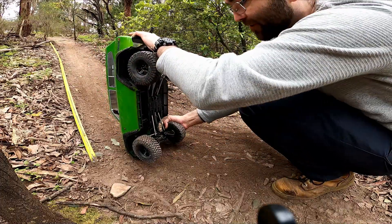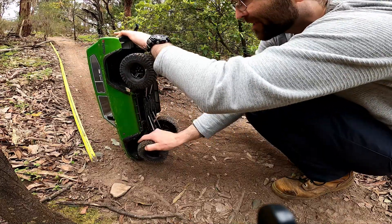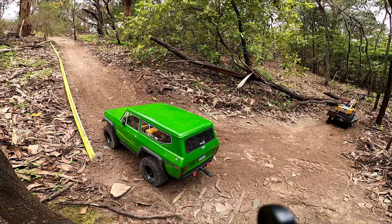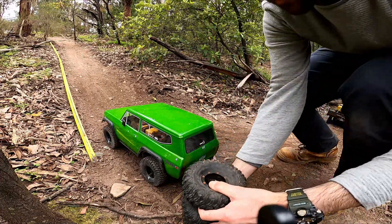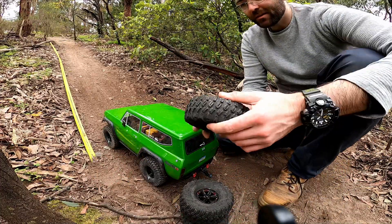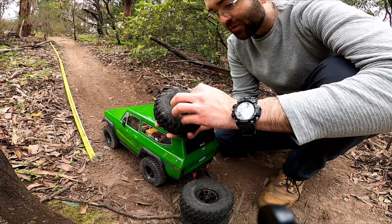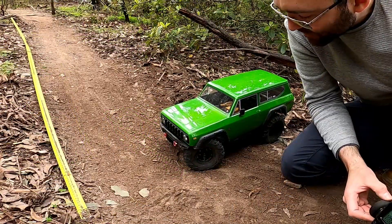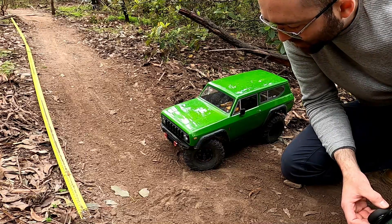When I first saw it go on the first round I thought it wasn't going to do so well, but then it pulled out 57.20 on the second go. Now we've had some really small tires and plenty of 4.7-somethings. Let's try some 2.2 wheels and 5.5-inch tires and see how they go. This is the Gen 8 V2 on 2.2s - it does fit but there is some scrubbing.